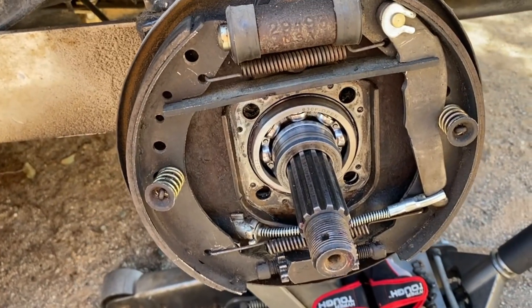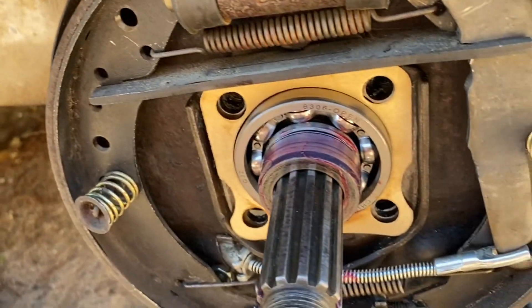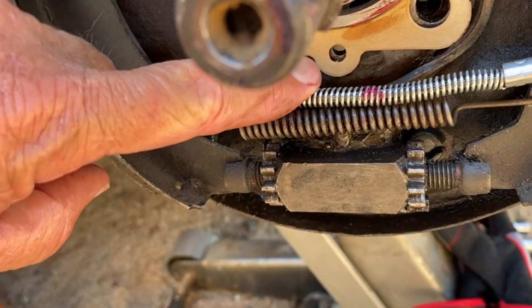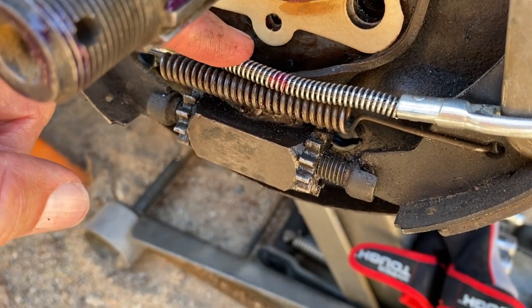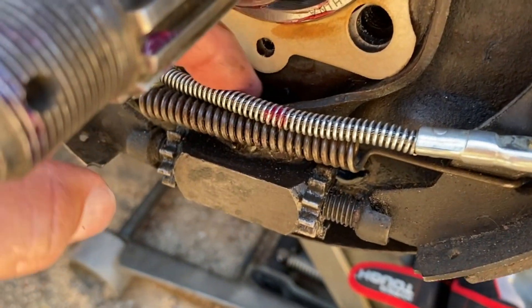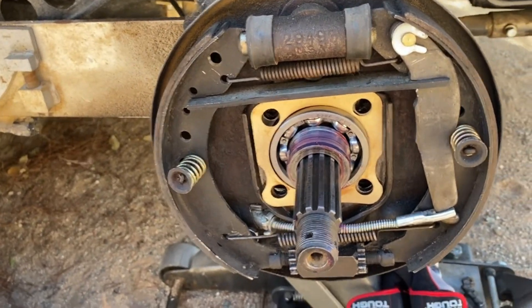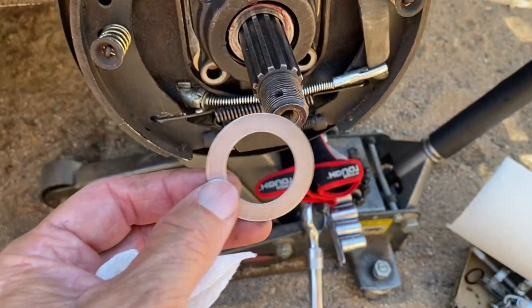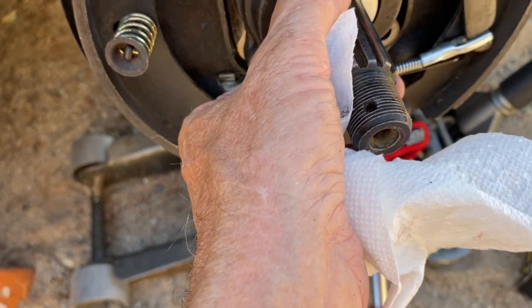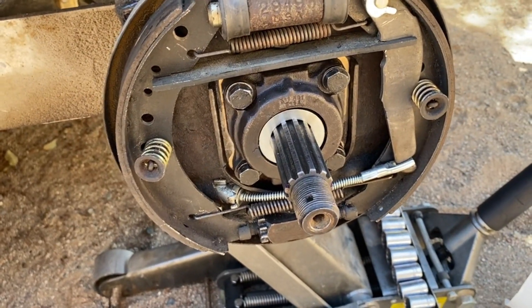Next I'm going to grease up the inside of the lip of this seal, fit it over there, put the gasket in place, and tighten it up. I put a light coating of grease on there and the gasket is in place — you can see this hole in the gasket lines up with that weep hole. This is the funnel-like thing I mentioned: if oil drips in here it will run out through a corresponding weep hole at the bottom of that funnel out the back of the backing plate. Now I'm ready to put the sealed plate on and put on the new washer — that's on there. Those are snug, and next I'm going to use a torque wrench to torque them down to spec.